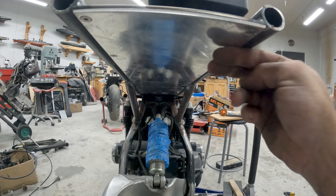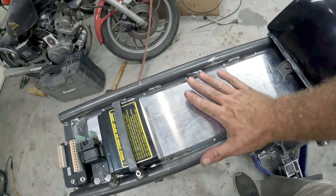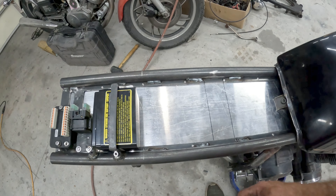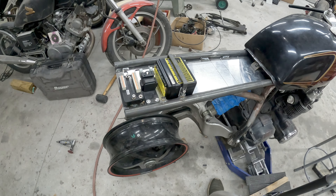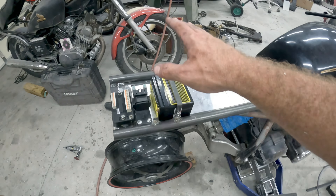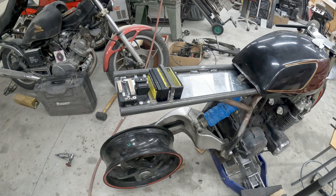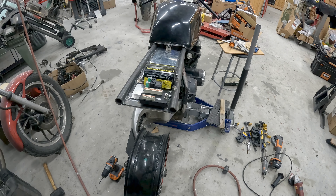It looks really nice — flush head screws in here — it's all done. Whenever the seat tray is made I usually use those quick-release hood latches. I'll drill a hole through the back underside here for the release; you just push the button underneath the seat tray and lift the seat assembly up. When I come back we'll most likely start a new episode and do the taillight section, the seat hump, and the seat tray. I hope you enjoyed — please like and subscribe, and drop any questions in the comments.